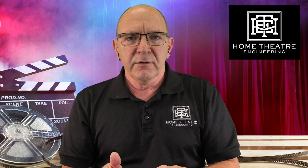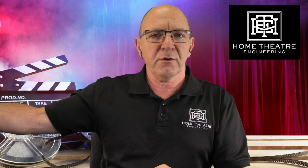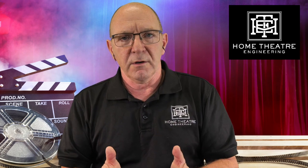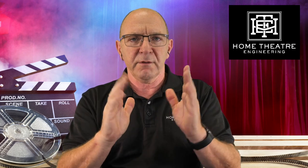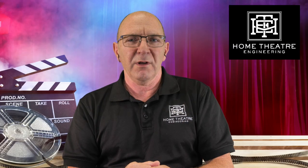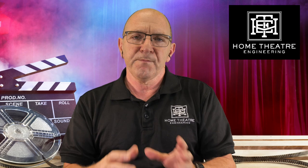The next option is an anamorphic lens. You can get these and put them in front of your projector. They cost in Australian dollars between five and $10,000 — though they certainly can cost a whole lot more. There are some really nice ISCO lenses and similar out there. Obviously the better the lens, the better the optics and the better the picture quality. The lens can be fixed in front of the projector, put on a movable manual sled, or on a motorized sled. Why would we do that? Because when you're trying to watch your 16x9 image and you leave the lens in front of the projector, there's actually some distortion. So the best of both worlds is to move the lens in and out, though for a lot of people that's a bit of a pain.